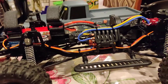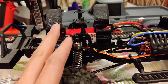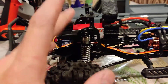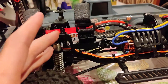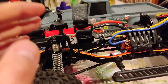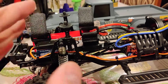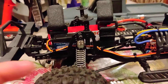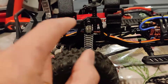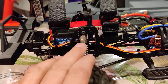What is the story with the Charisma shocks? I took them apart, as I said in my previous video, and played with them. I tried 20-weight oil and they still felt tight and stiff. I tried 10-weight and it softened up a little bit, but still a little stiff. If you look at the valving on the piston inside the Charisma shocks, they use a four-hole piston, which has plenty of valving. If it were an emulsion-style shock, you'd probably need 30-weight or better to get decent dampening.